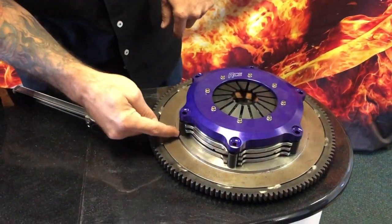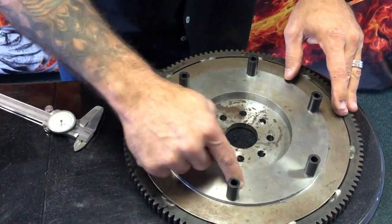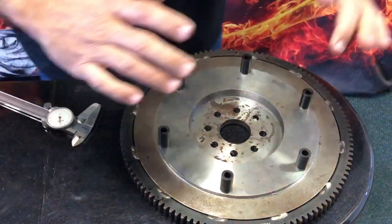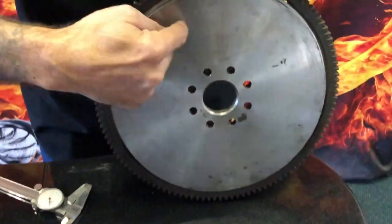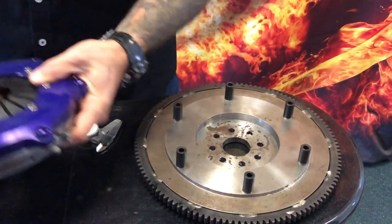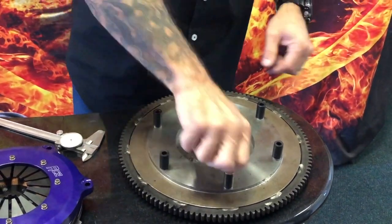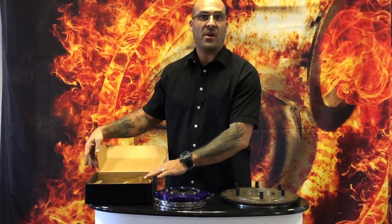That'll obviously bolt down through these little locators. We've CNC machined this flywheel — this happens on a CNC. We've actually machined these slots at a specific depth so that you get a specific foot pressure or clutch pressure on the clutch pedal. Then obviously this entire assembly fits down onto there and you get the supplied bolts which will bolt through those sections. These are not through-hole tapped, but this clutch is quite thick so we've drilled it quite deep and cut thread into the actual flywheel, so these bolts will go through the entire assembly through that locator and screw down into the flywheel, holding the actual clutch down. As you tighten these bolts you'll see the fingers on the clutch will depress and tension up ready for your installation.